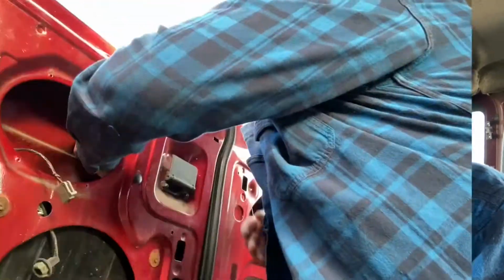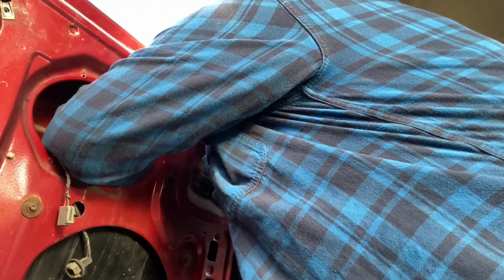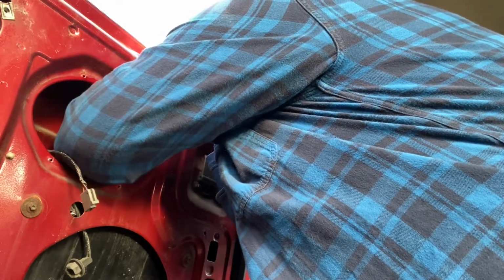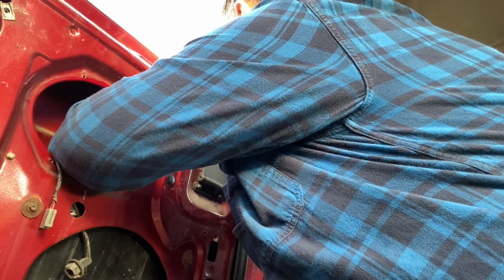One thing that is very common in these things is that the door handles break. And it's usually the cables that have broke, like these, they got these plastic tips on them. And usually that's what breaks. So I watched a quick video and seen which wire to pull, came out, was able to get it open. But then we shut the door and now the cable thing don't work. In here, it's just like it. And there's supposed to be like a second cable, and I just don't even feel it. I think the whole second cable is just broke off completely.